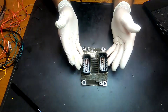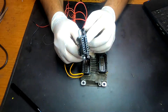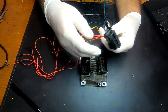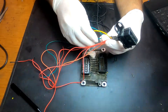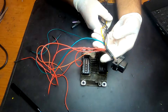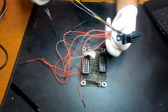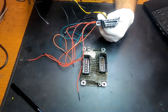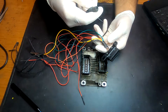I made this cable using an OBD female connector from a car. I connected pin 16 which is positive, pin 7 which is K-line, and pins 4 and 5 which are ground on the OBD plug. This 12-volt supply is to power up the ECU so I can turn it on.